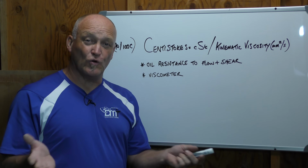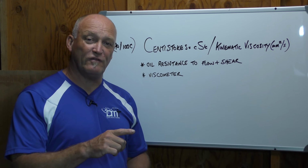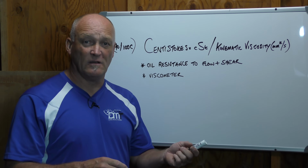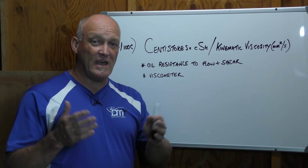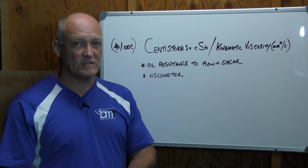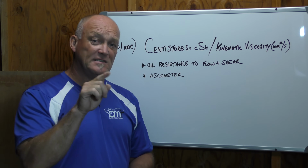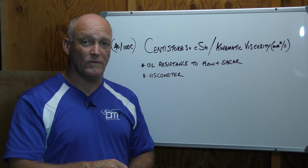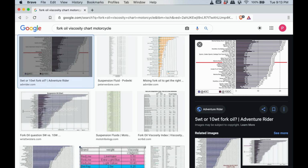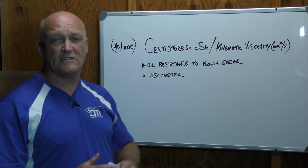The problem is with the fork oil industry, there's no regulation. So somebody's 2.5 is somebody's 5 is somebody's 7. And unfortunately, we are very grateful to everyone that took the time to post all the fork oils and all their viscosity index and Centistoke indexes on fork oil viscosity charts via Google. All that research is there for you, all the brands are there for you, and all the numbers are there for you. So why do we need to know this?